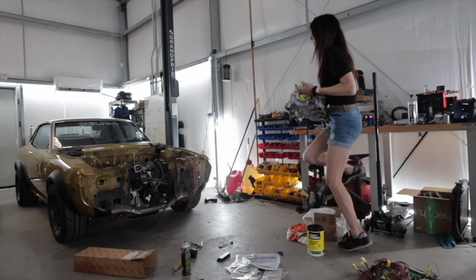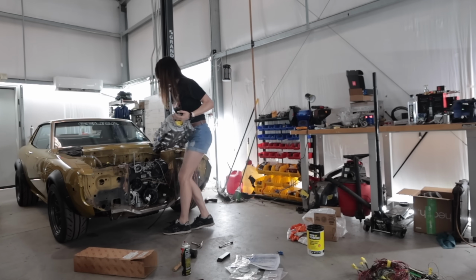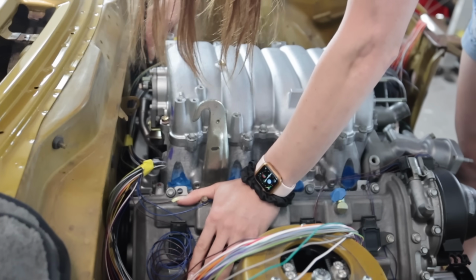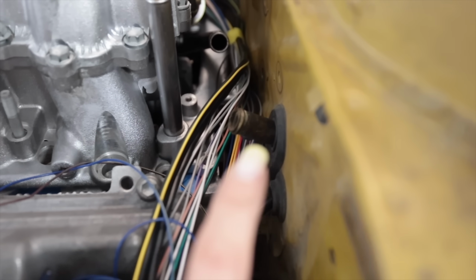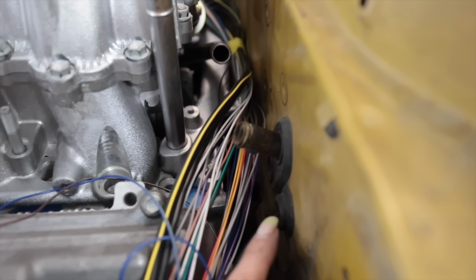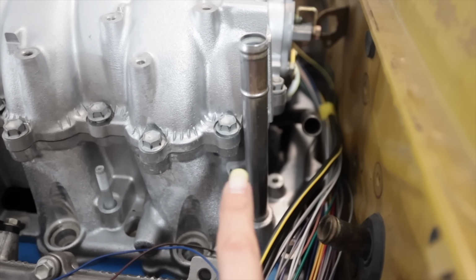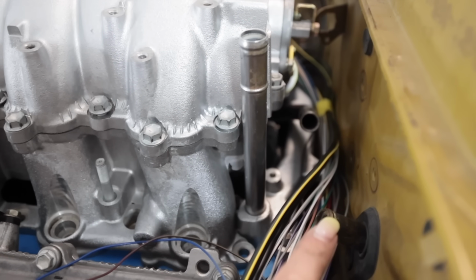The only thing that's keeping me from installing this intake manifold permanently is I have not figured out this water pipe yet for the heater core. I have the other pipe kind of just flopped down loosely sitting in here right now. I was gonna try to make it follow parallel with that coolant bridge on the back half of the engine. That way it could connect to the other hard pipe, which is down inside the car right now, but it comes out right here. And then this one right here can just get cut down and reflared, and a hose can just go right to this guy.